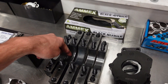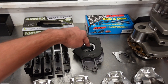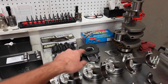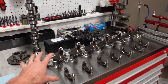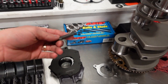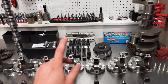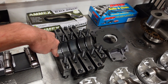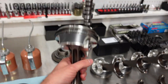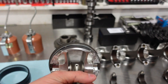We are running tri-metal bearings throughout this engine and we are going to run the Melling 10295 oil pump. I don't like to run the 10296 high volume pump in these larger displacement fully forged engines, so we like to run a standard volume high pressure pump and will be installing the Copo pressure relief spring. For main bearing clearance I am running 2.3 thousandths, the same on the rods. My top ring is gapped at 26 thou and our second ring is gapped at 28 thousandths.